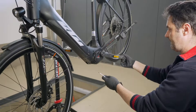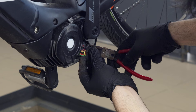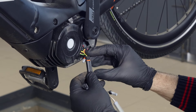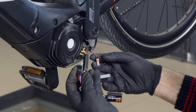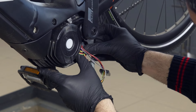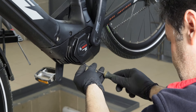Now let's move to the second, easier version with this KTM with 4th generation motor. Here you don't need a crank puller. Simply remove all cover screws and remove the two plastic covers. Remove the two connectors and again install them into the Speedbox wiring. Just refer to your Speedbox manual because the connectors have totally different positions. Again, plug the Speedbox connectors back into the motor, find a place for the device, feed back the two engine covers, and you'll be ready.